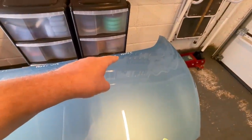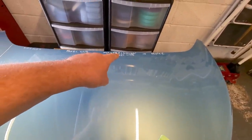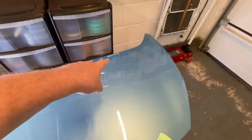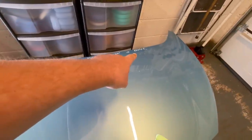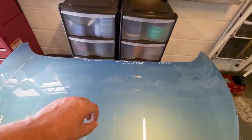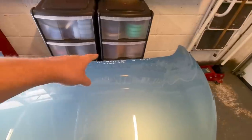But the reason I like using the primer is the fact that I don't have to do really any of this, potentially. Especially with my garage environment, so I can just finish out the car, buff it, wait a day, then come back and coat it, and I haven't got to touch it. The waiting a day is a pain. If you're going to panel wipe with gel and prep after an hour, you could say, well, I might as well just use a finishing polish and panel wipe. But then this will show us the difference.